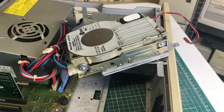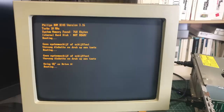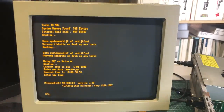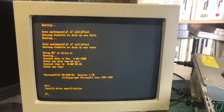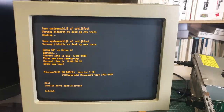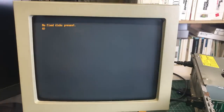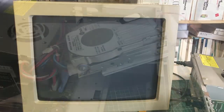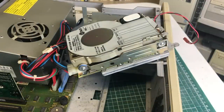To my surprise, when I turned on the machine with the hard drive just laying on top of it, I noticed the hard drive was indeed spinning — that seemed like a good thing. But unfortunately I still had the internal hard disk not ready message. So I decided to boot from a 5.25-inch floppy into MS-DOS. There I noticed there was no C drive, and fdisk couldn't find any partitions or fixed disks. We first need to get rid of this internal hard disk not ready error.